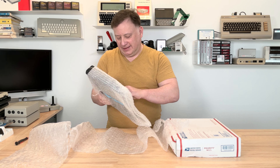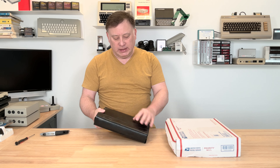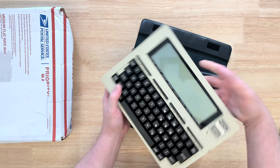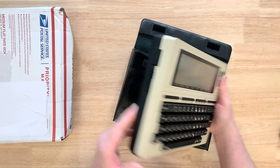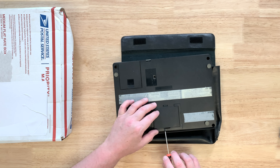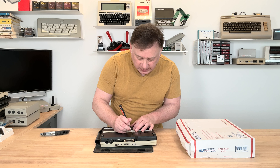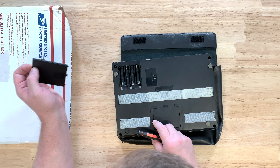It's another Model 100. If you watch eBay enough, you can get these at a good price — especially if they're untested. Usually the battery inside dies, the thing won't boot, and it just needs some repair. This one needs a little cleaning — East Shore Center, wherever that is. Good thing there's Velcro in there. Let's see if this has that bonus ROM I was expecting. Nope — no bonus ROMs in this one. Let's turn off the memory switch there. No batteries in there — looks pretty clean inside. That's a good sign.